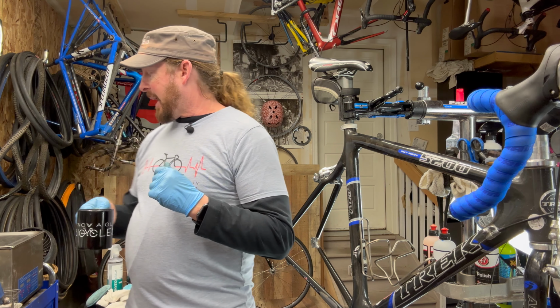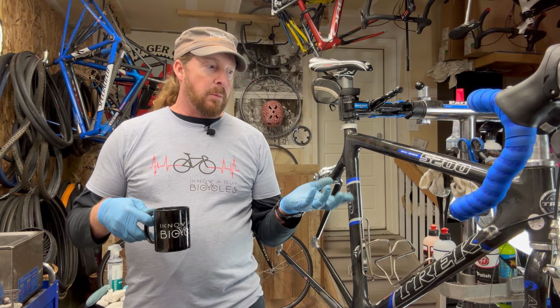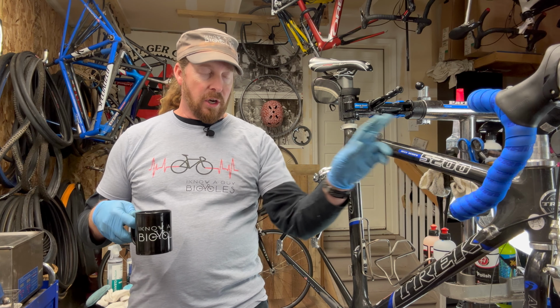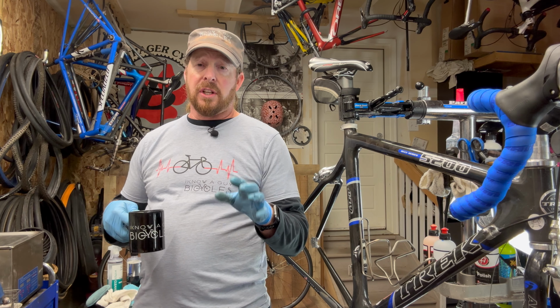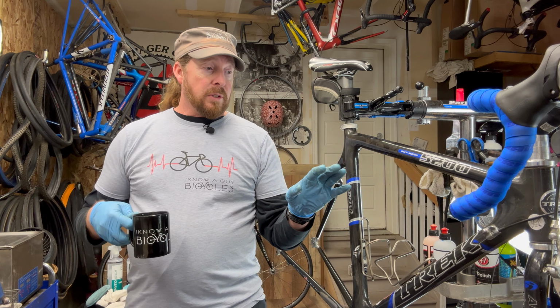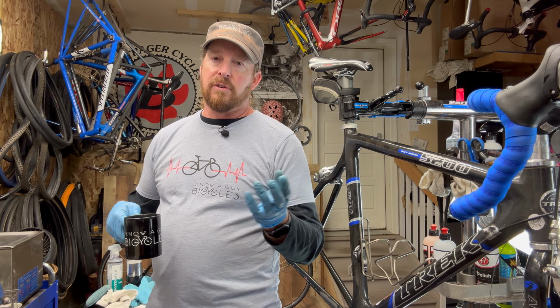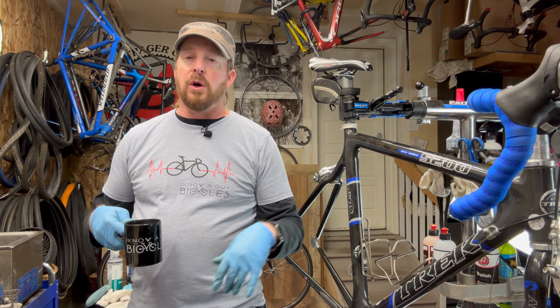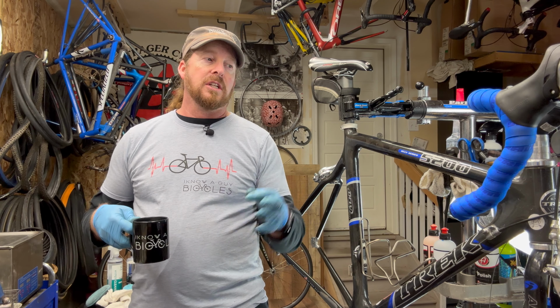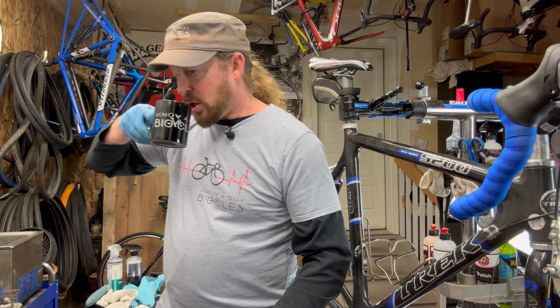So looking at what I have, I'm not going to do any buffing or any of that nature. I've already done that initial refurbishing. So what there is left now is just the clear coat. It still probably has a little bit of polish left on it from the Adam's treatment. Now I'm going to use a Lithium surface cleaner to pull up any of the little dirt bits and so forth within the actual paint itself, and then apply a ceramic coating called Ceramic Slam from Lithium, which will actually give it a protective coating to shed water, UV protection, and you can use it also on the rubber and plastic parts and the aluminum arms and pieces to kind of give it that additional protection. So let's dive into this.